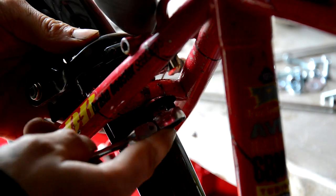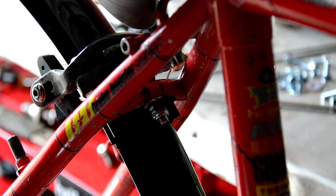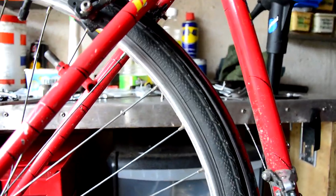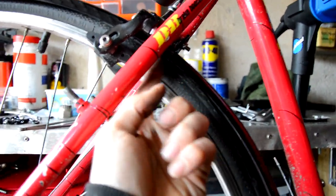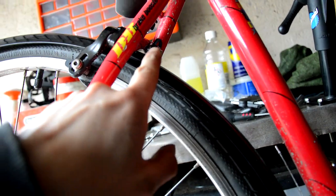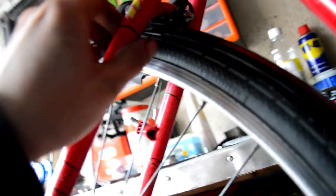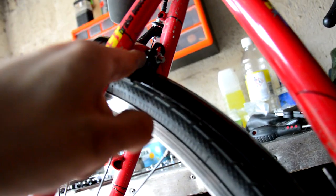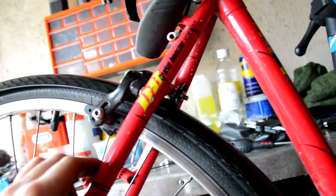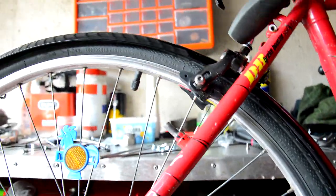Because you don't want it hanging too low. Now that's in and on — back in. I'm just going to be checking the clearances I've got around. Mine is super tight, especially underneath this bridge here. Just check you've got the clearance around and you can fit the tyre in it. What I could do if I needed to raise the height — this bracket here is touching the bridge. I could just take that out, flip it round so it's supporting at the back, and then I could lift the guard up a bit more. So if you've got that trouble, there you go. But yeah, that's going to go on now, I just need to put the stays on.